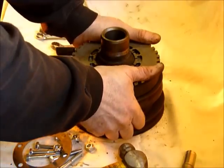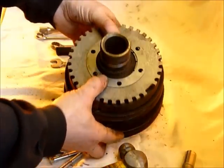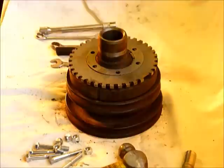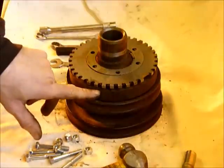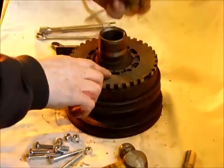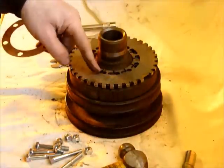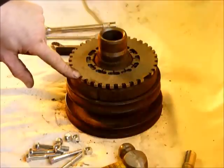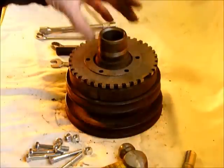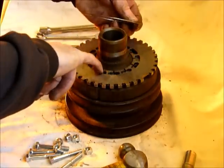Push down and that locks it into place. The locking ring goes on top and you will see the bolts can be put through and tightened back up again. If at any time you find that your bolts don't line up because the bolt hole is where one of the slots are, turn the trigger wheel over and try again. These slots are machined out of sync with the teeth so you actually get two goes at lining it up. The locking tab on the back is there to help make sure that the nuts don't collapse into the tooth.